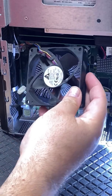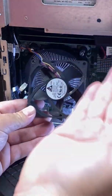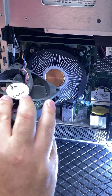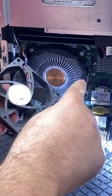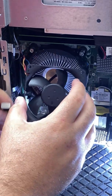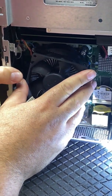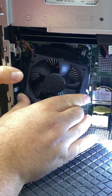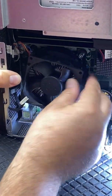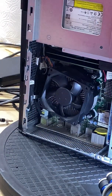Now all I'm going to do is take the label side face down — I'm literally going to flip it 180 degrees. The label side is going to face down. All you do is line up the little pegs that go into the holes of the fan, line it up like it was before, push down, and you'll feel it snap into place. Now you've turned this exhaust fan into an intake fan.